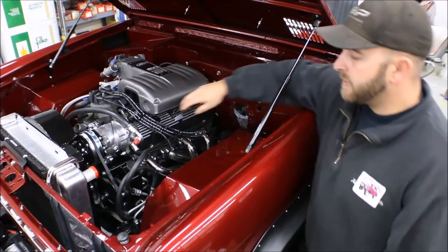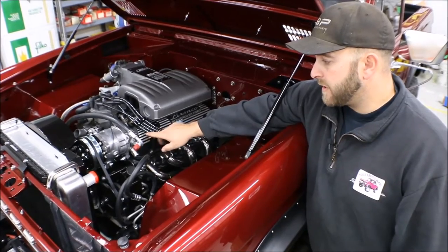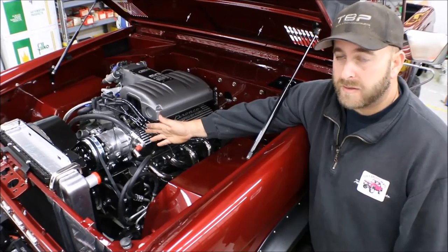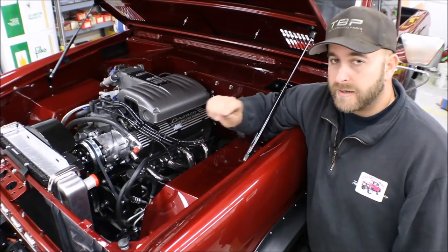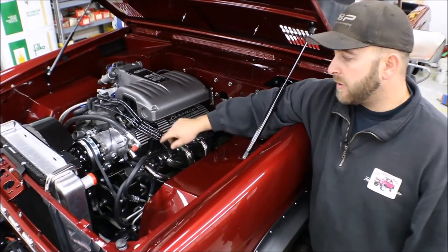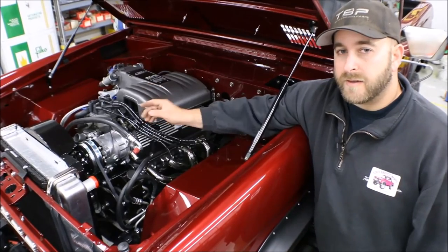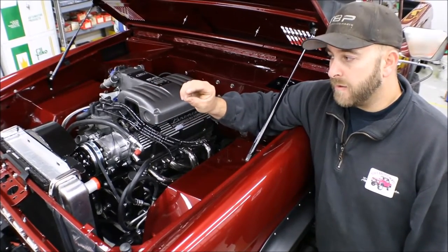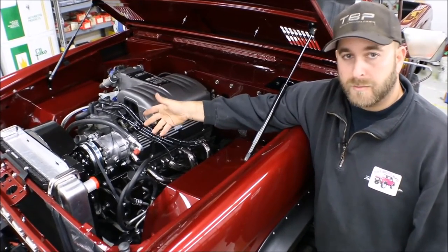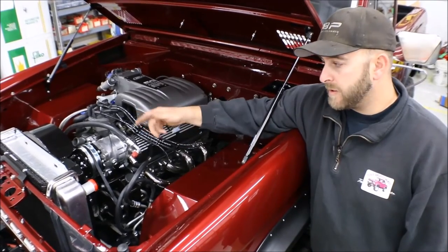When you do that you run into a couple more things that need to be addressed. One being you'll be really close to your valve cover — you'll have to take a die grinder and take a little bit of material off the valve cover itself. You'll also have to take one of these bolt heads that is close to the valve cover and trim the profile of it down to about half of its head height. That'll allow it to bypass and clear when you go to tension the compressor unit to tension the belt.